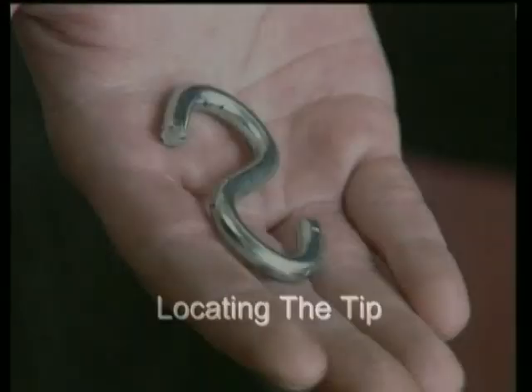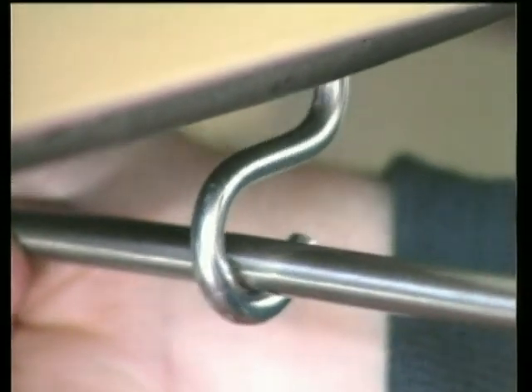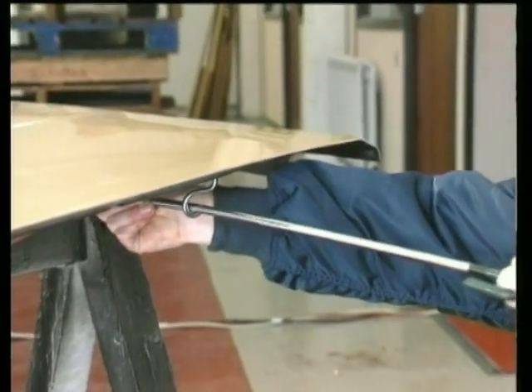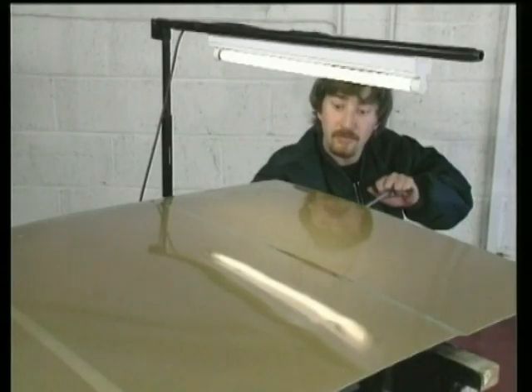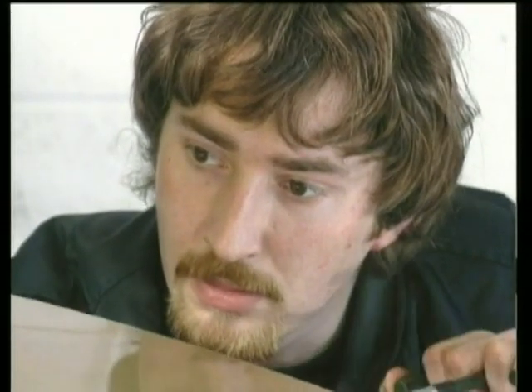You will now learn how to use the light to locate the tip of your tool. Take one of the S hooks in your kit and hook it into a convenient spot at the edge of the bonnet. Put the rod into the bottom of the hook, grip the handle so that the tip is pointing up, and move the handle so the tip contacts the underside of the bonnet. Look underneath so that you have a good idea of where the tip is located. Then move yourself so that the reflection is in that general area. Now apply gentle pressure to the handle to push the tip against the metal and slide the tip around slowly whilst you watch the reflection. If moving the tip is tricky, apply some oil to the shaft so that it slides over the S hook more easily. At first you may need to apply a lot of pressure to see this effect, but once you know what to look for, use less and less pressure.